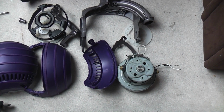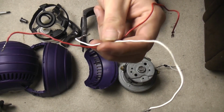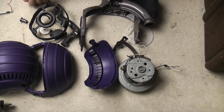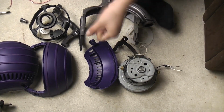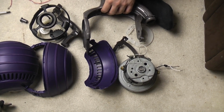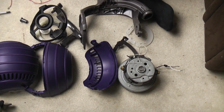Certainly, oh no it's not, wait, we need the yoke loom wires itself. These are very common to break, especially the red wire due to the way it is routed. If your brush roll stutters on and off, especially when you move the machine, you need a yoke loom, but that's not for this video, although there is another how-to guide for one of those on the Manchester Facts website.